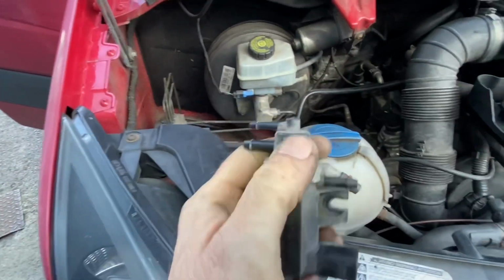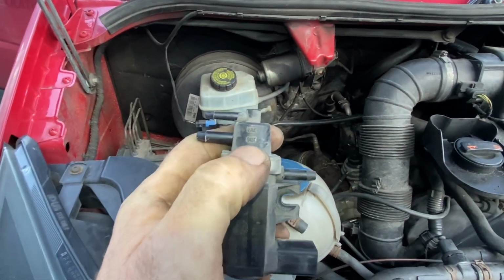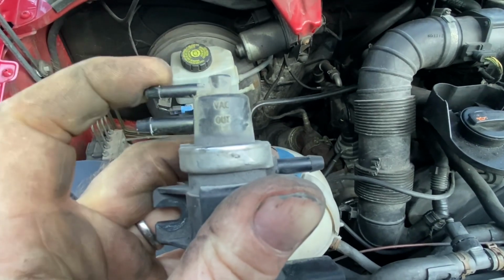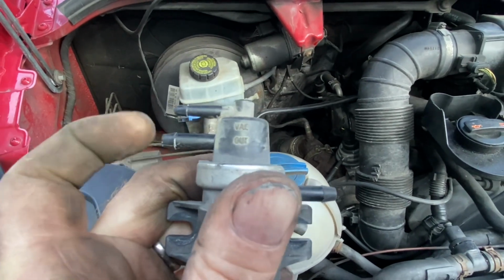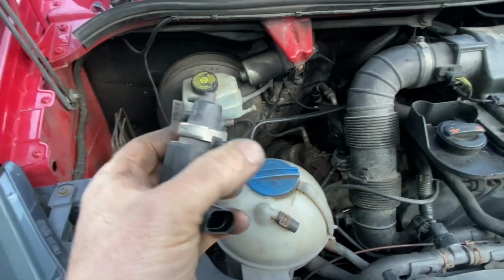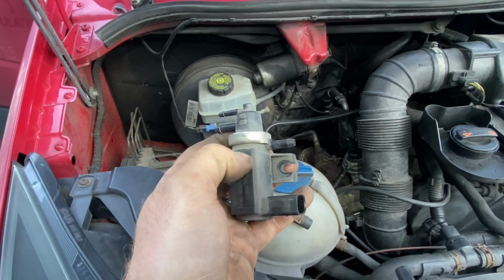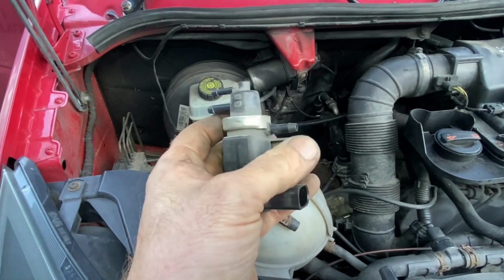Just to show these yokes, Sandy Anderson, good man out there doing, which you all know of, changed one of these recently, and he had two pipes the wrong way around. It shows actually on the Volkswagen one. So vacuum comes to that pipe there, and then out, that's the control side of the pneumatic side of it, the vacuum side of it is here. This one then is only going to an air box, so it's only just looking for fresh air. So movement of the solenoid inside it creates, what would we call it, air dissipation. So this thing moving has a little puff, puff, puff, puff, just allowing for movement inside it, but it just doesn't want any dirt getting in here.